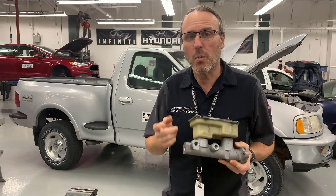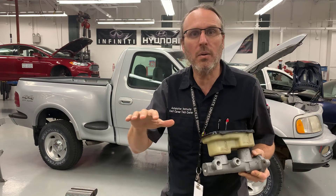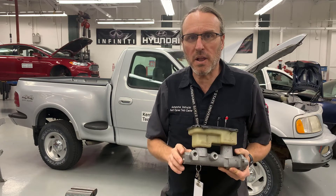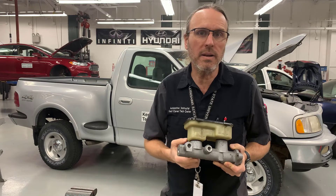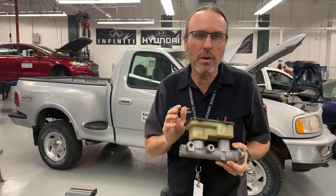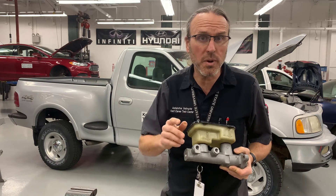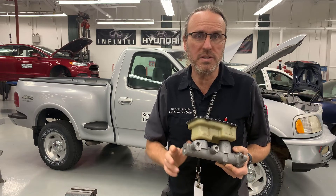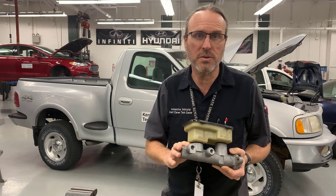In order to do that, we're going to take one apart and lay it all on the table on a paper towel. We're going to have you label up the parts and reassemble it. After that, as a class, we're going to go over the different parts of the master cylinder and how to diagnose it — how do I know if our customer needs a master cylinder? First we're going to take it apart so we're both looking at the same pieces and know what we're talking about when discussing the internal parts.